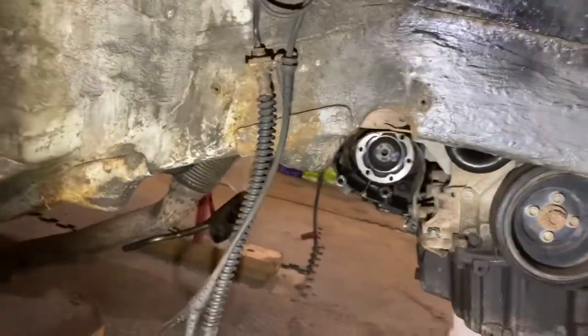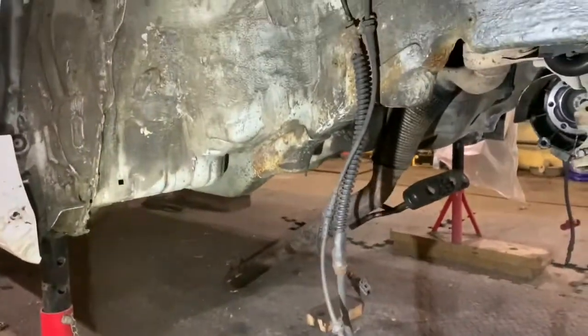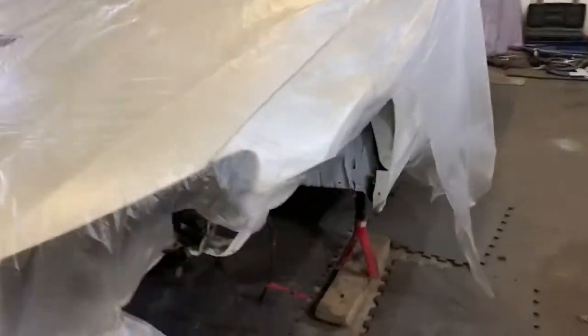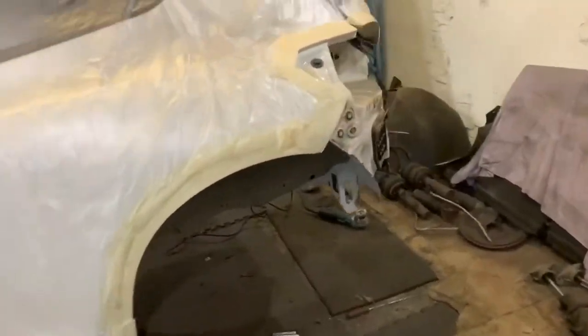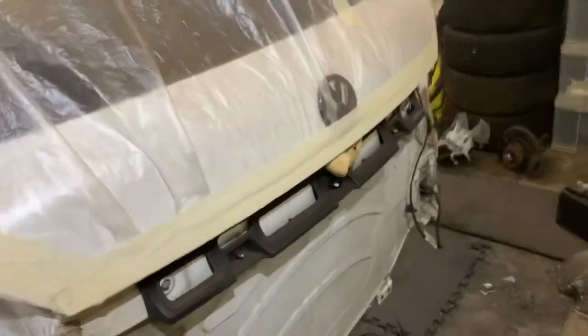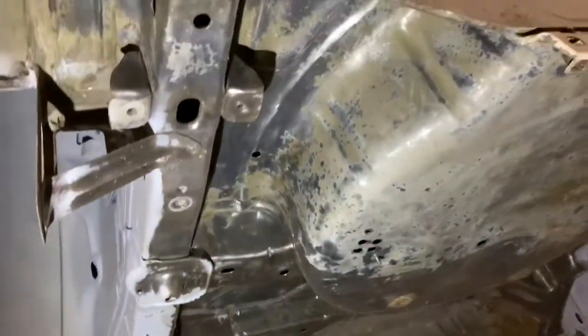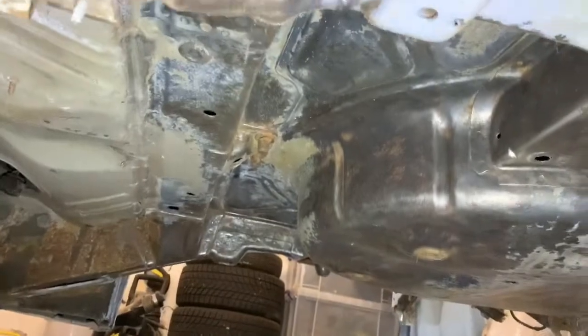The chassis notch will be getting sorted out a bit — it's a bit small just now for my liking. And I'm also going to take the DPF off when I get under there. As you can see I've got most of the car covered up. I haven't neatened up the front yet because I'm still going to take off the wings. Around the back it's all taped up so it should stay pretty clean until it goes back together. I started underneath here today, so there's massive seam sealer everywhere — it's all coming off but it's going well. It's going to take a long time getting everything back to bare metal and keeping it rust free.